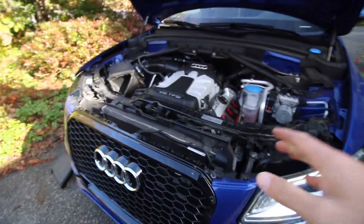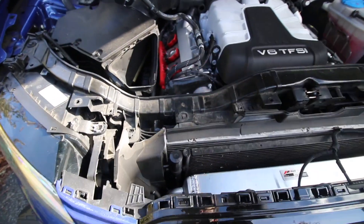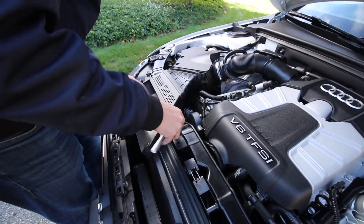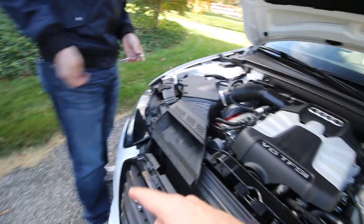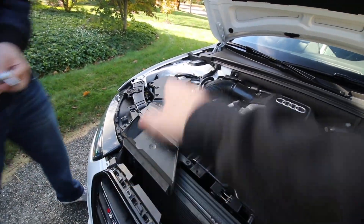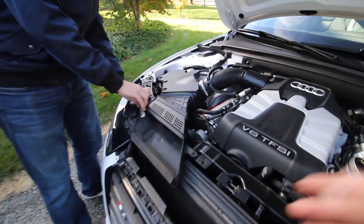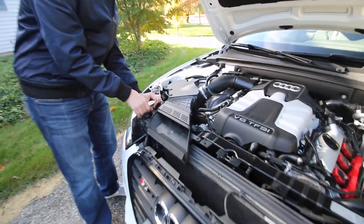Let's get the cars taken apart and roll from here. In today's double install the first step is removing the plastic cowl and also taking off the little intake vent there — we'll put that back. In order to get access in here it makes more sense to take it off, so it's two T25s. Alex is rolling on his right now and we're both going to take these snow shields off, which are just little mesh screens. I kept mine on as long as I did because I was worried about water in the winter, but now that we have an open filter, if water does come in it'll just drip straight down — it's not going to hit the filter at all.